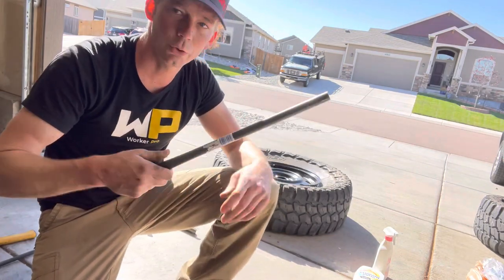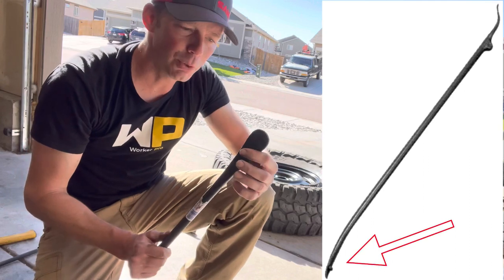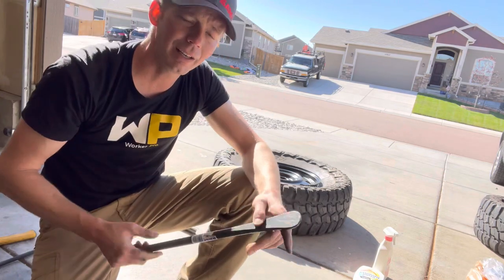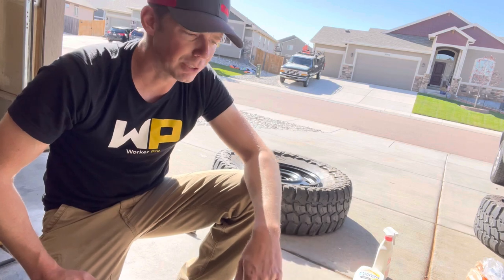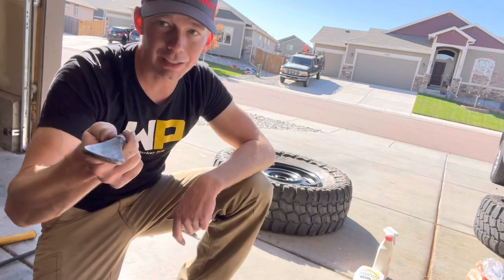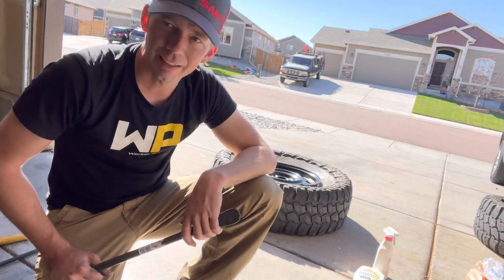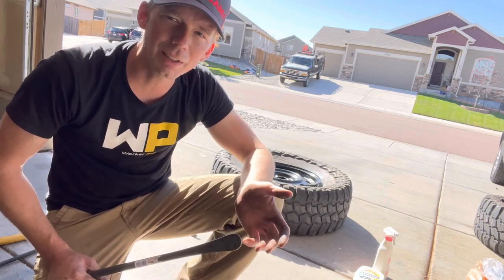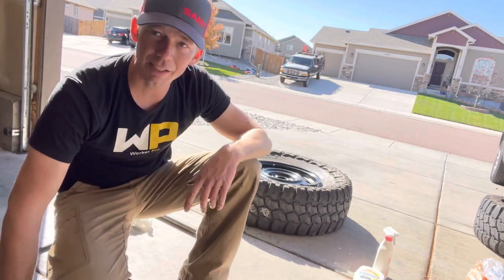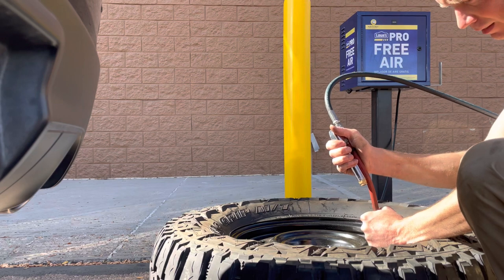Kentool is like the quintessential tire iron — it's got a little hook on one side and a spoon, and a little knob on the other side. That knob is nice because you can get it to lock on the rim when you're prying, for removal and installation. But it's only this long — I could have bought a longer one but we're trying to keep this in budget. You've got to justify the budget to the wife, otherwise she's like, 'Why didn't we just rent one?' But that's done, let's go get some air. This bead over here doesn't want to seat — proper lube would help that.